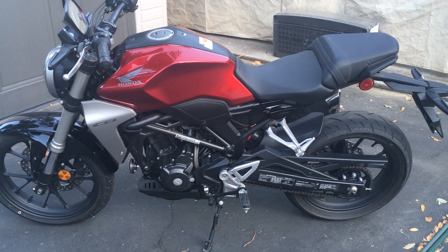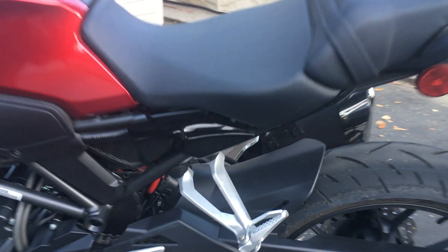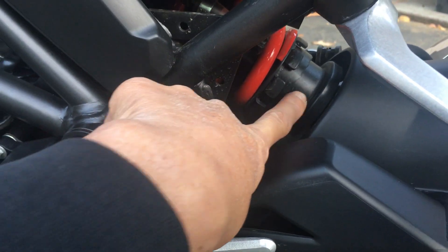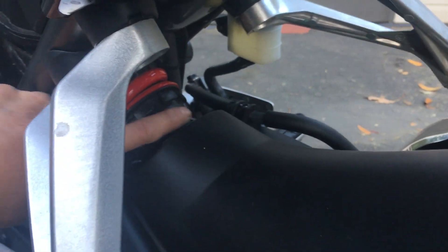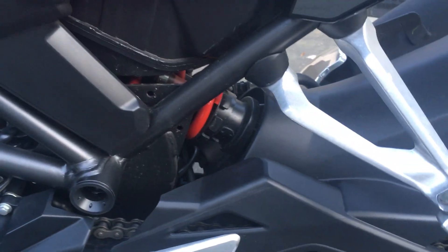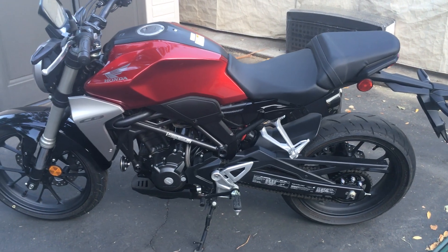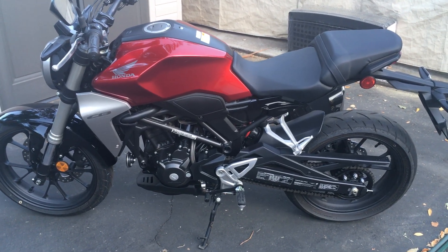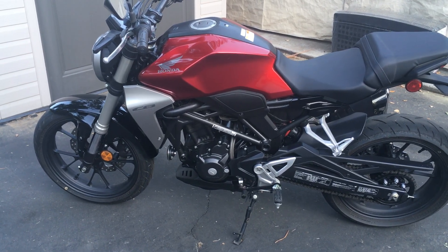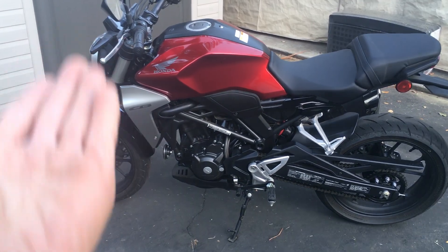This is only the first ride and I haven't adjusted anything suspension-wise. The preload has seven adjustments and it's still at the factory setting, and it actually feels pretty good — maybe a little bit firmer than I might want, but the spring rate feels real good. Dampening feels pretty good too — it seems like it has more rebound so it doesn't just pop back up too fast.